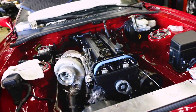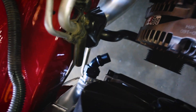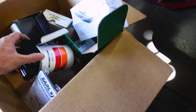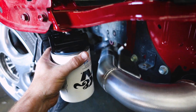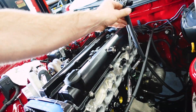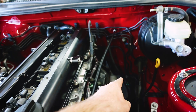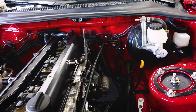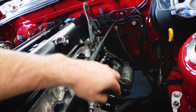We're kind of mocking stuff up. If you look closely down inside you can see there's a cooler down there - that cooler is for the power steering. We're also going to put a pretty large 25-row oil cooler under the headlight on this side and mount the oil filter relocation over here under this headlight. The problem with having such large intercooler piping and large filter is you start to run out of space and have to move components and route plumbing to the other side. We've finished all the fuel lines and plumbing and the fuel filter - dash-8 all the way up to the radium filter, which is a 6-micron filter so you can run ethanol, then it tees off and feeds both sides of the rail. The return comes out the middle of the rail, down to the regulator and out.